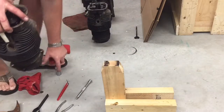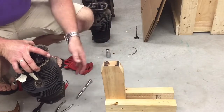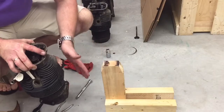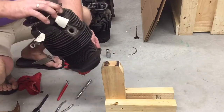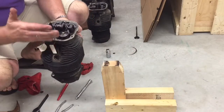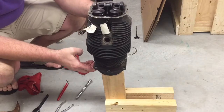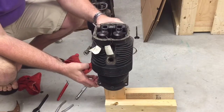What I've done is I took and made a little stand here out of a 2x4. What you want to do is set your cylinder jugs over the top so the 2x4 is running this way. You want to line it up so your valves are sitting right on top of the 2x4 and just slide it down there gently.